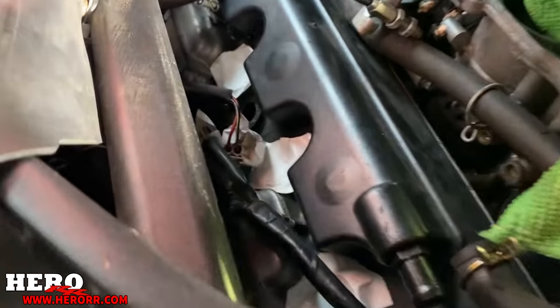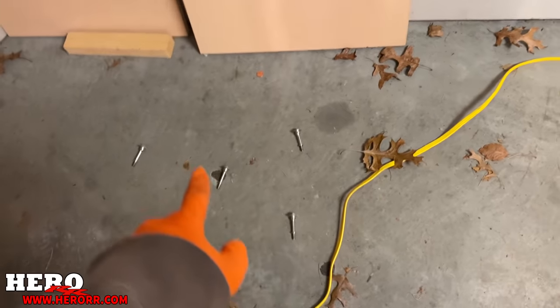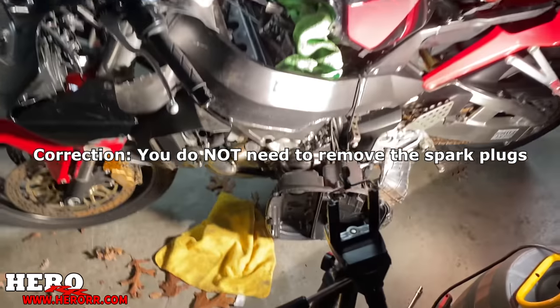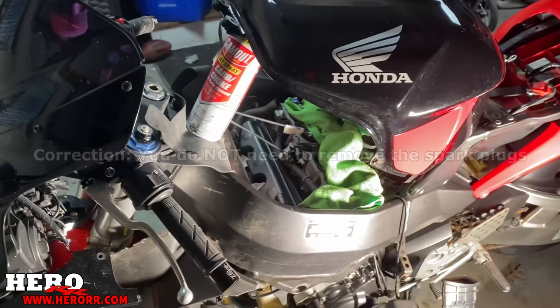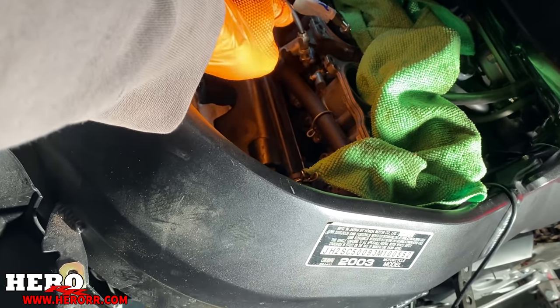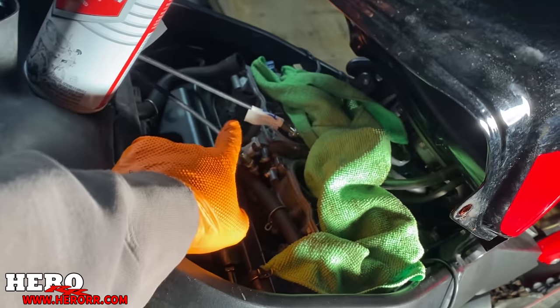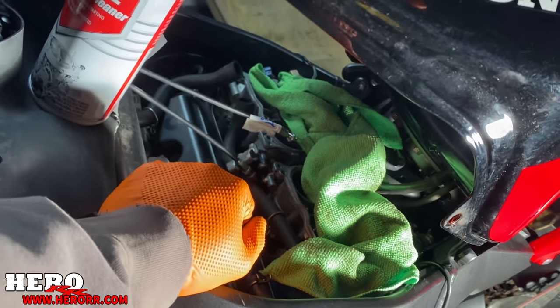Okay, so I got the plugs all out and all the bolts out. Everything is removed from the valve cover. Those are the bolts right there — there's only four of them. So four spark plugs and four bolts basically hold this thing on. Now we're going to have the fun task of removing the valve cover. I already unhooked these cables — they're still hooked in down there — so maybe I can maneuver this cover around that cable. Hopefully I can, but we'll see.